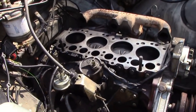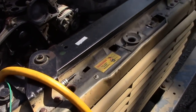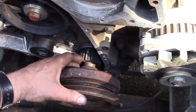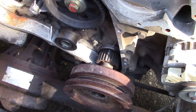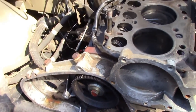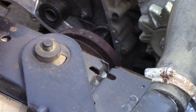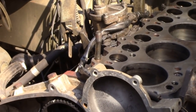It's a lot better to do with a pin — nothing's going to move. I want you to see the position of the pistons, so I'm going to screw that pin in. These 2.5s did chatter on the keyways, but this is nice and tight, and so is the front pulley. I have no concerns about taking that apart — there's been no oil leaks — but I am going to change the tensioner and the belt. So with the pin in, listen very carefully — you hear it clicking — that's the timing point to put the belt in.